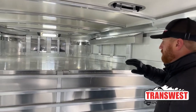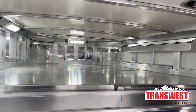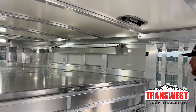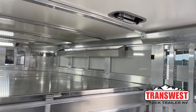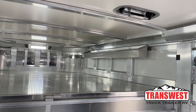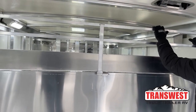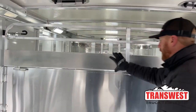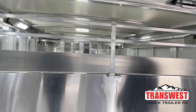Up in the nose, there's a basic deck. Over to the right is a tray for plexiglass — basically an oversized brush tray like you see on horse trailers, but it's four foot long so we can store those four-foot sections of plexiglass up and out of the way. We also put lights up there for coverage in the nose. And there's a gate that folds up with a lower section of aluminum so any items that slide back are caught before coming down into the stall area.